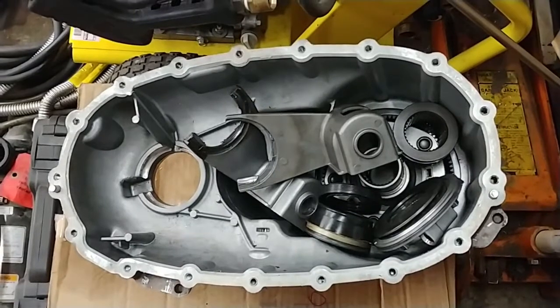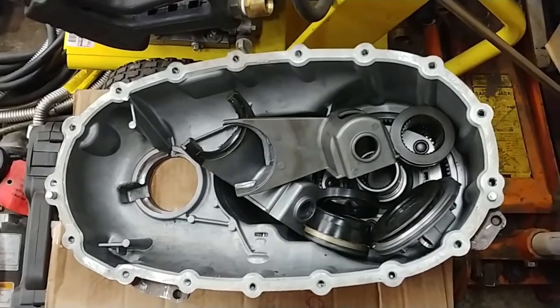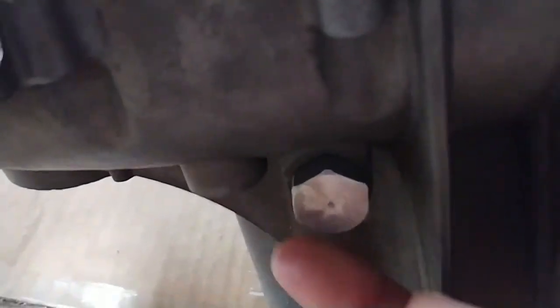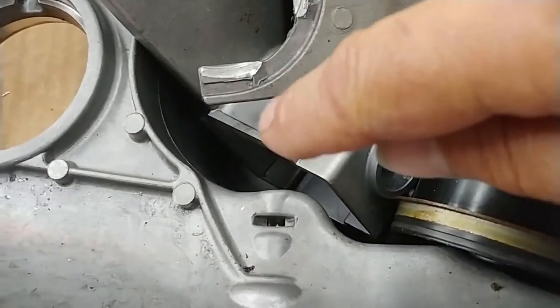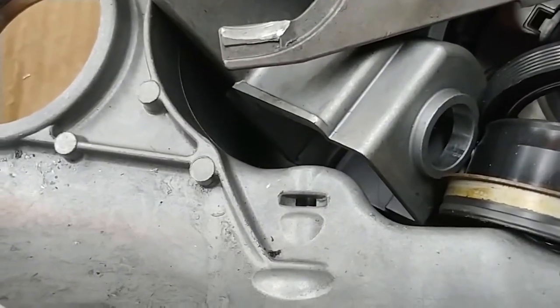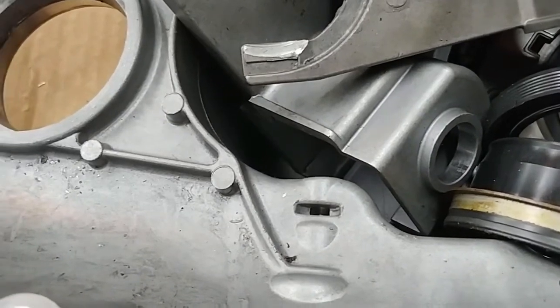It wasn't actually, how do you say, an exact fit. It wasn't a perfect fit. It had some things that are notable about them. Mainly, if you look here, this right here, which is on the outside also, this nut, there's a plunger in there, and that plunger works to give a positive stop for the motor, the electric motor, to know exactly what position it's in: four high, four low, or neutral.